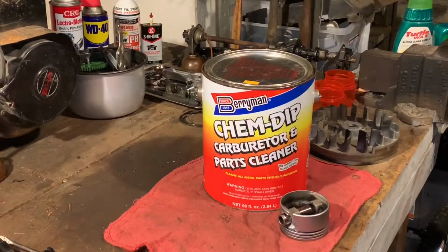Alright, tubes, so what happened with the carburetor is I couldn't remove the float pin to get the plastic float off. So I took it outside to spray some spray carburetor cleaner on there to loosen things up. I'm working in a basement shop right now. Always take things out if you're going to spray any kind of cleaners, carb cleaner, starting fluid, spray paint. Go outside. Those fumes can cause an explosion or fire for real. It's happened to people. So those parts are outside soaking.